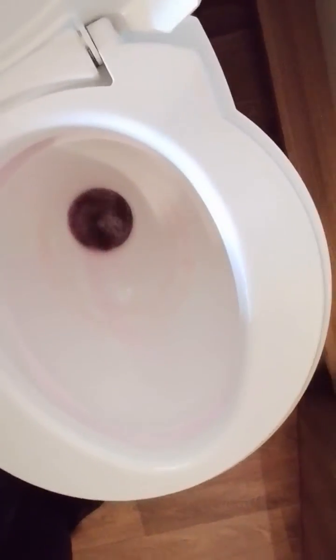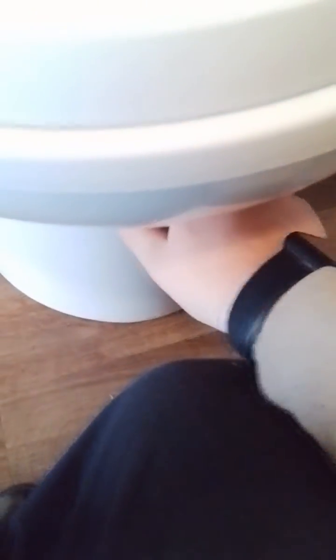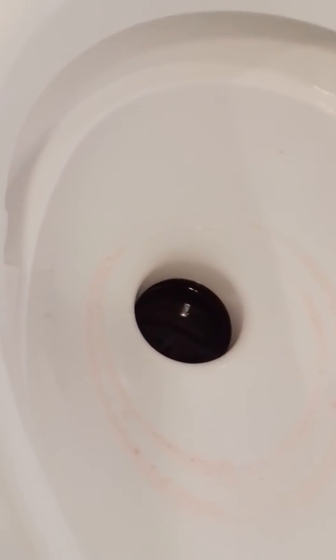Towards the back, in your bathroom, you have your Thetford flush. When ready to flush, press and hold the button until you've put enough fluid in there to wash everything away. Then below me here we have your little handle, which if you push it away from you and then back, it opens the flap at the bottom, which empties it into a cassette, which can then be taken out and emptied and slotted back in. Also around the van, you have the vents, which blow out the hot air from the boiler.